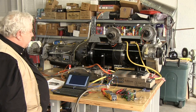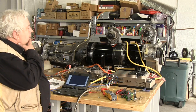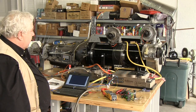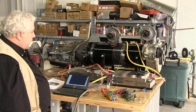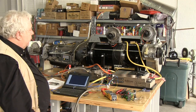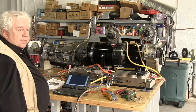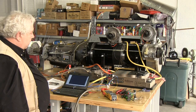If that'll keep that transmission pumped up and keep that air conditioning going and my power steering and brakes, that's what we'll be at. I think with two motors like that, I can idle at that low in RPM and have enough torque there to be able to keep everything going. With one motor, I'd have to be up at 600 or 700, but I might actually be able to idle there at 400.